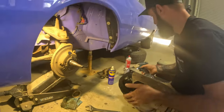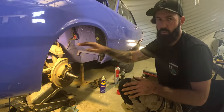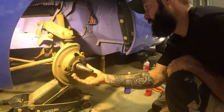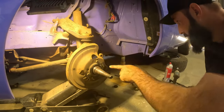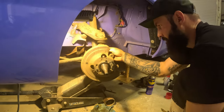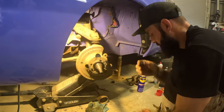So that's fully taken off now. Don't forget to readjust that, otherwise you'll be tucking those wheels and you'll be hitting bump stops — we'll do that later. So that's all that tension taken off, and we've got the majority of that tension on the jack now. Still got pressure on the stand so we know we're still safe. You can see that's lifted it right up — before it was pushing down on that nut, and now it's off.